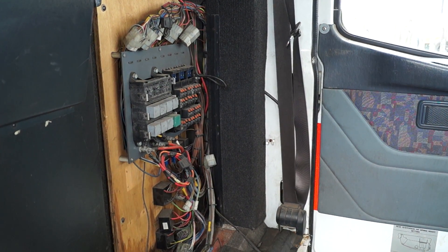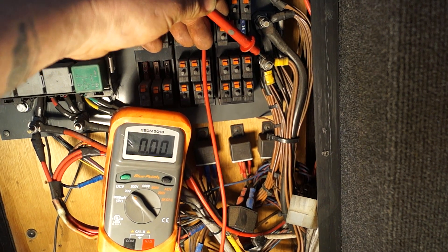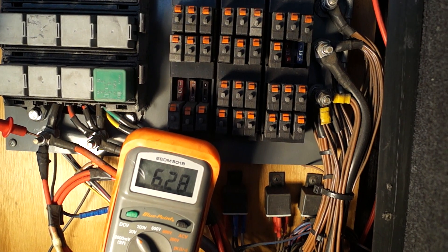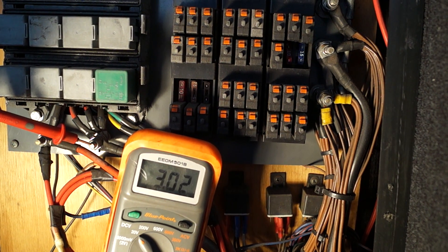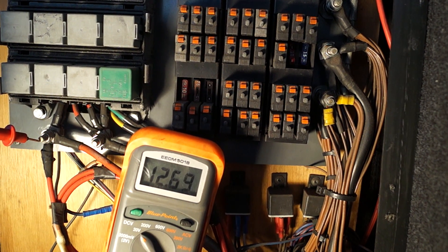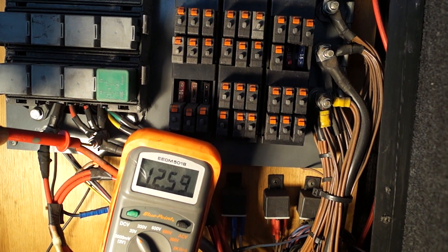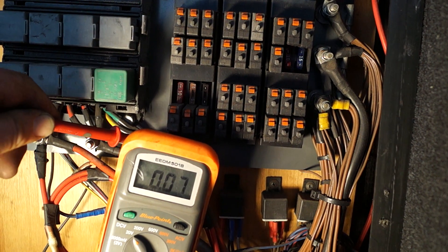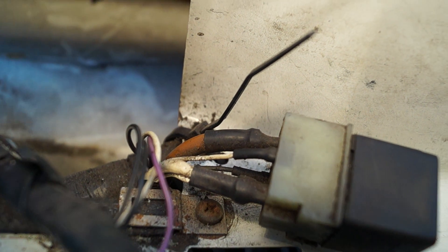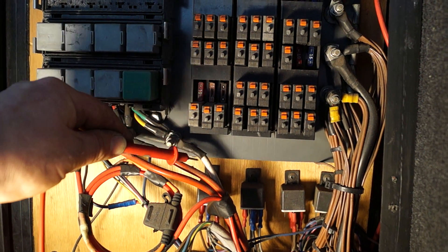On this specific vehicle it is hardwired for a lot of auxiliaries but it also controls the main vehicle wiring loom. The brown here is for earth and red stays constant because it is power from the battery. I also have a connector here which has a white wire into it — this is 12.69 volts direct from battery, and this is 12.596, roughly 12.65. The other circuits are also energized because this relay has been energized, giving power to the rest of the vehicle via the board. And there is our white wire there.